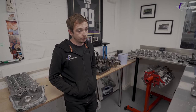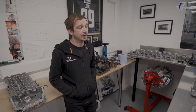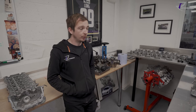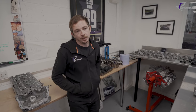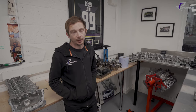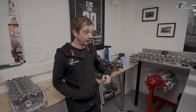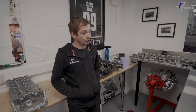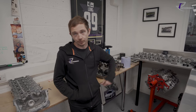It's why we've gone and bought a combustion pressure sensor, so we can understand what is actually going on inside the engine, what we're pushing cylinder pressure wise, because it's all an unknown. It's calculated, but it's nice to back that up with actual data. And the only thing worse than no data is bad data. So we've bought that so we can do pressure waves on the inlet port, pressure waves on the exhaust port, and cylinder pressure.